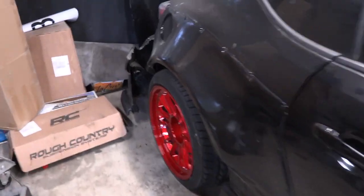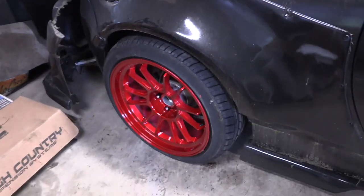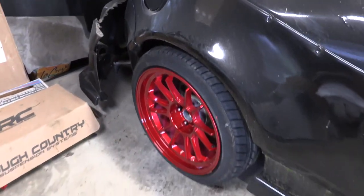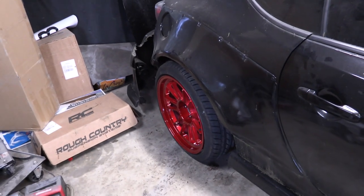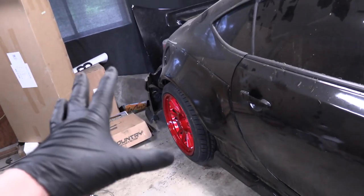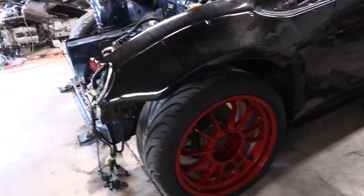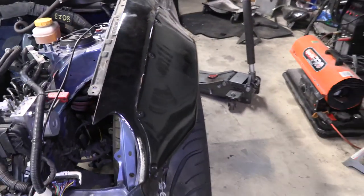Let's look at the back first. It looks pretty flush, a little bit of poke out there. I think this two-incher will work. If we went to one inch it would bring it in quite a bit more, and the only thing I'm worried about is right under here where the waterproofing starts — so if this thing bounces even just a little bit it'll hit the waterproofing. It'll just make a light scrape sound, it'll clear the fender though. And in the front, without an engine it's really really high because there's not enough weight on the car.